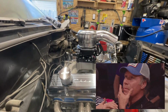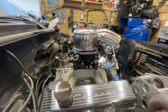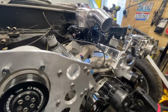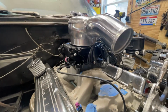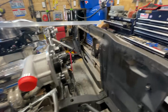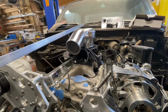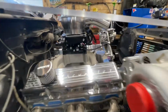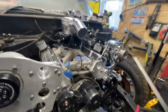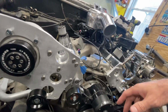Well, I think this might introduce some hood clearance issues. It looks cool, but look how tall that is. Let me get the old straight edge. Yeah. This isn't perfect, but it kind of depicts where the hood line is. I could gain an inch, but I really want that spacer in there because I don't want to overheat this thing. I mean, it's kind of silly now. I was worried about clearance here for the coolant lines. That wouldn't be a problem.